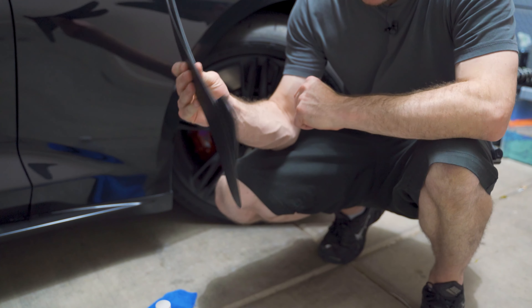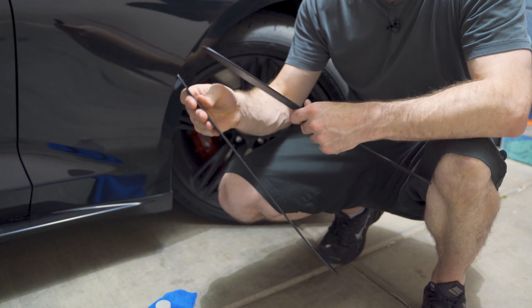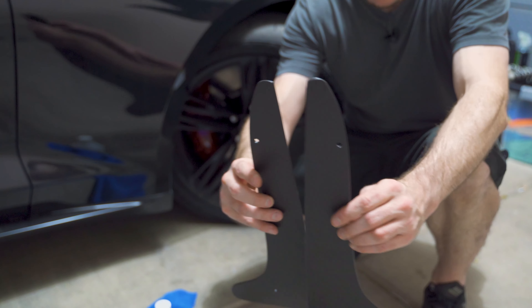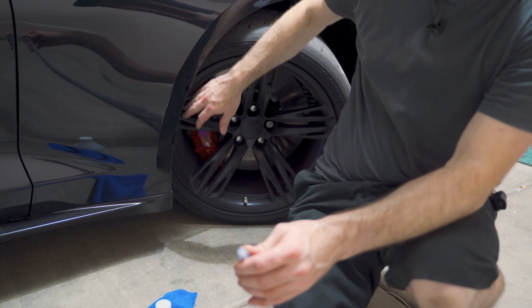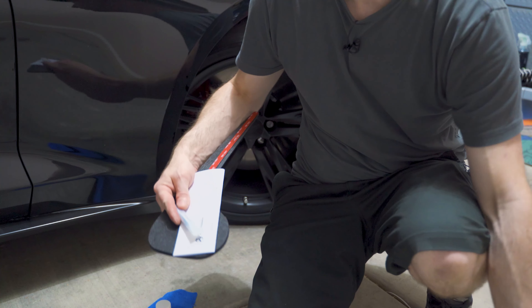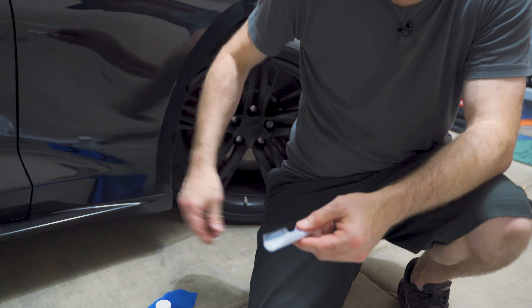So like I mentioned earlier, we're going to be installing the ZL1 add-ons rock guards — these are the deluxe version. The deluxe version has one textured side and one smooth side. The textured side will face towards the rear and the slick side will be the side that catches the rocks. You can order these as either front and rear separately, or as a combo. If you order them as a combo, the ones that are thicker up at the top are the rears, and the thinner ones with the 3M strip are the fronts. Also keep in mind the ZL1 uses a different set than the standard Camaro SS, so make sure you order the right set. I'll link both the SS set and the ZL1 set down in the description.